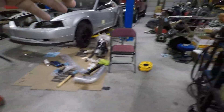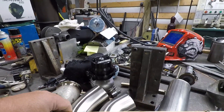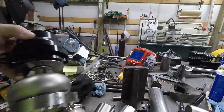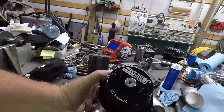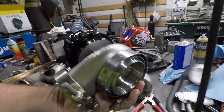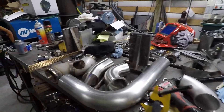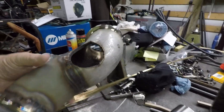The next step was to put the wastegate in. I'm getting ready to practice TIG welding with some silicon bronze. I was getting ready to use the precision wastegate to go into my hot side, so I had to pierce a two-and-a-half inch hole for the little stand. Here was that hot side pipe that I had built previously.